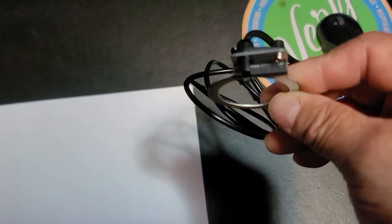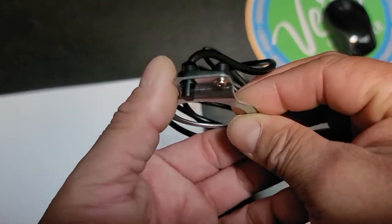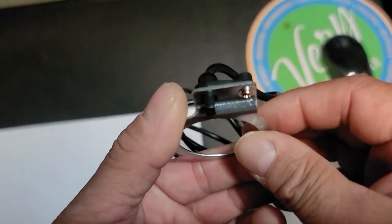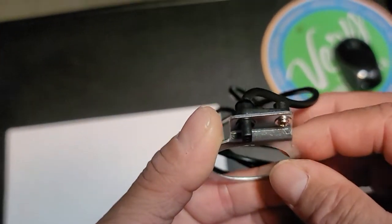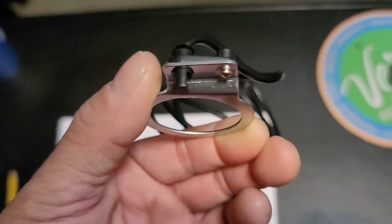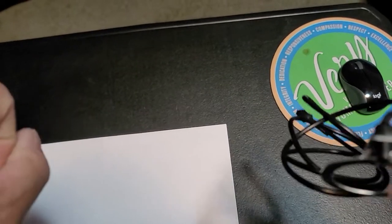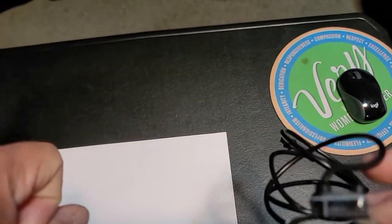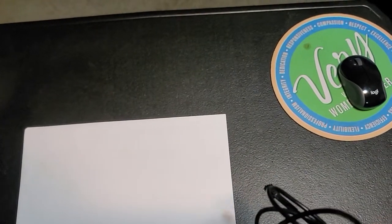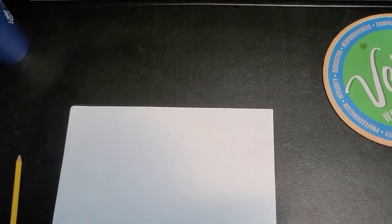And then your controller gives a signal to your motor, or sends the correct voltage and amps to your motor, causing you to go. And the thing is, most of the time it's higher voltage and higher current than your actual throttle would give you. Because on a class 2, we all know that you can only throttle up to 20 miles per hour. If you want to go above 20 miles per hour, then you have to use your pedal assist. And most people hate that because they want to throttle up to 28 to 30 miles an hour without using the pedal assist.